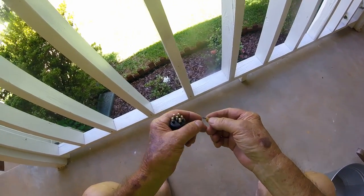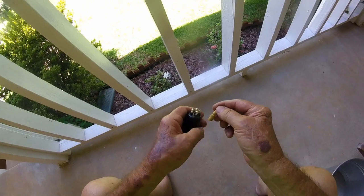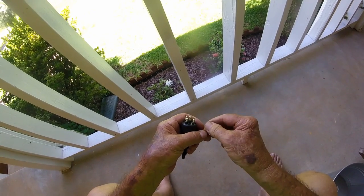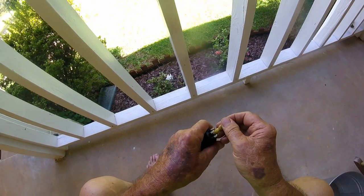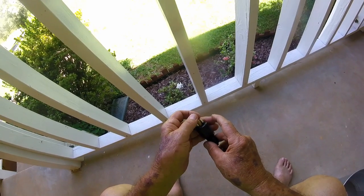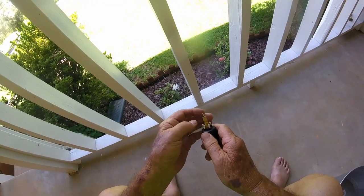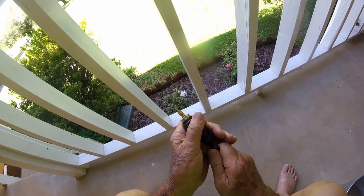I went up under the console and found a wire hanging down to some kind of light that's never been used and probably never will be used. It wasn't the same kind of connector and didn't even look the same, but it was a barrel type connector and it slipped right on there real snug. So I reached up in there with my wire snips and cut about that much of the wire off — it was hanging down under the console. I pulled this thing off, went to the ignition switch, and shoved that piece up on there with a little pigtail wire about that long. It snapped on there real snug. Got my wire strippers and stripped off a little bit of wire, stripped off the wire where I cut this off, and twisted it together. Probably should have soldered it, but I pushed the key in and I heard the solenoid click.